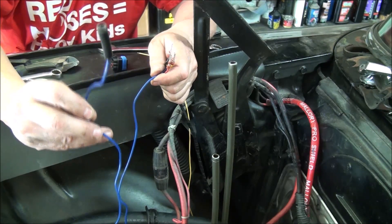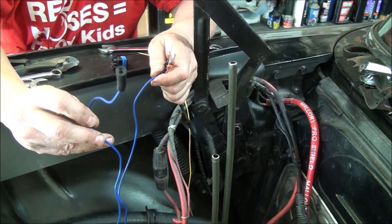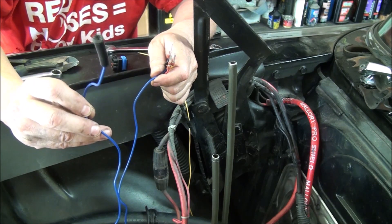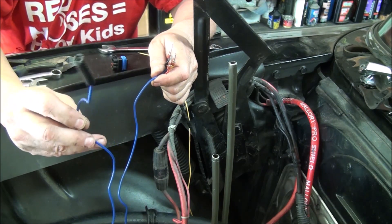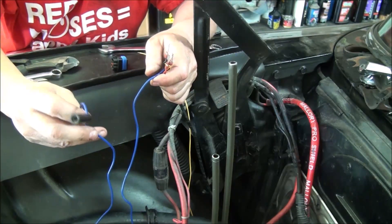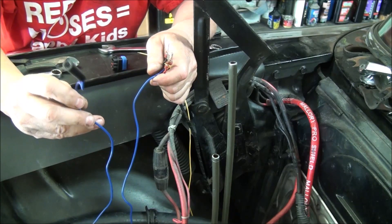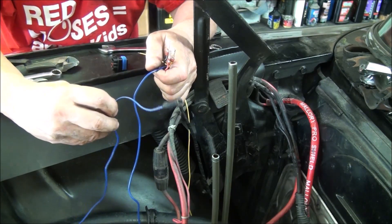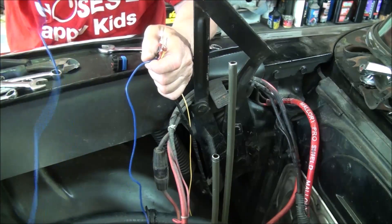I don't know what safety equipment there is to prevent damage to the air conditioning unit on the inside. And I can tell you for a fact, if this is hooked up directly to the compressor, there's no safety equipment on the compressor. So we're going to fix that, and we're also going to shorten it, because originally the air conditioning compressor was on the driver's side — the left side of the car — and now the air conditioning compressor is on the passenger's side of the car.